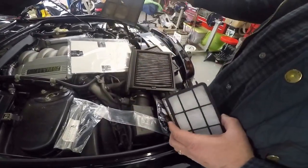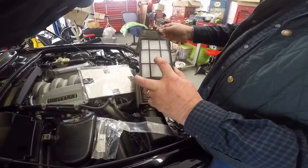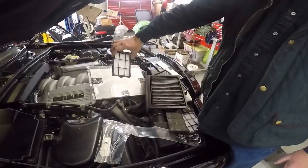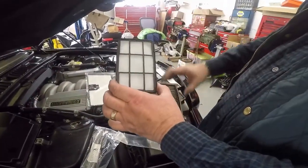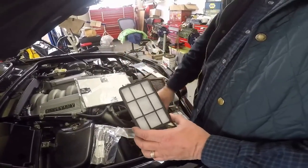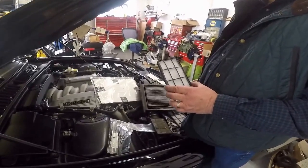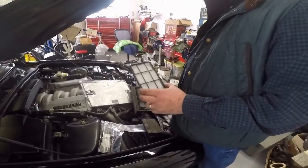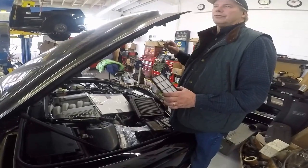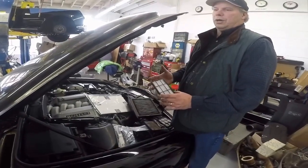Here you go, folks — you're breathing this or you're breathing this. I can actually see through this clean one — it's so clear. We can't see through the dirty one, obviously. The restriction from a dirty filter like this can lead to very expensive repairs — thousands of dollars between parts and labor for blower motors, resistors, control modules for your HVAC system. It just goes on and on versus just replacing these filters. It's a no-brainer to do these filters.